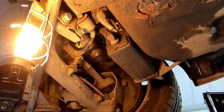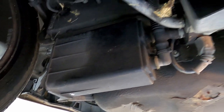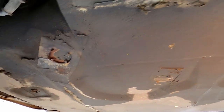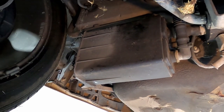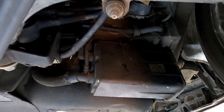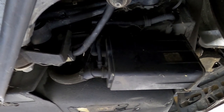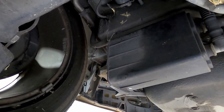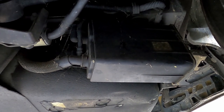It's a little easier on a two-post lift, but it's doable on a four-post lift. I want to point out these devices on the front side of the spare tire wheel well — this large box under here is not your fuel tank, it's actually your spare tire well. These are the charcoal boxes that help capture emissions from the fuel tank and fuel lines heading up to the engine, then push them back to clean things up. The exhaust runs right beside it, so be real careful when you put your exhaust back in not to have it touching the charcoal box, because you're going to get a rattle.